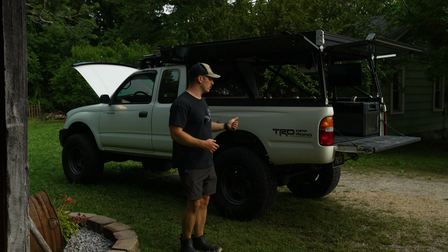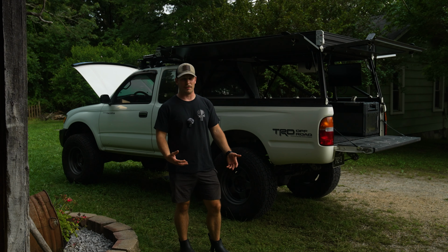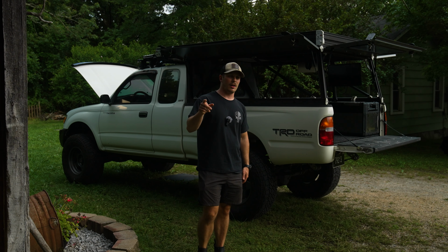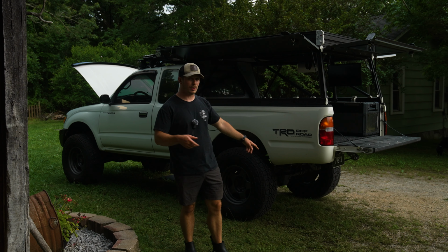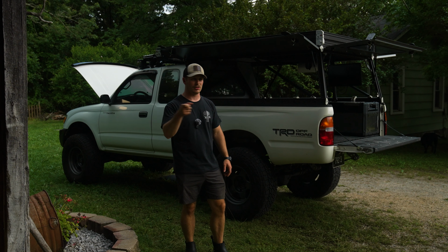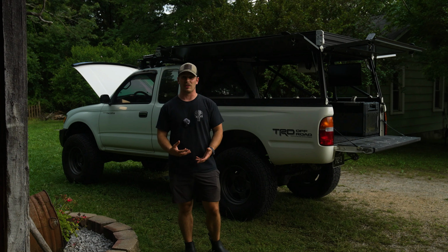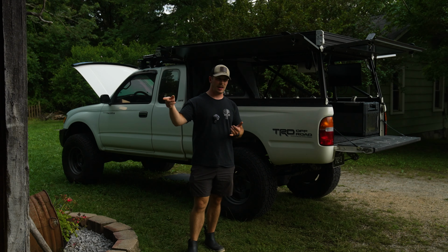But then the bad news, may as well break it to you because it's not something I can solve in today's video because I had to order parts. Essentially, that P0420 code that I thought maybe my catalytic converter was bad or something else was going wrong. I hopped underneath the truck this morning, put my vacuum on blow and put it up the tailpipe so that I could spray down the exhaust and see where soapy water was bubbling from, and see where the exhaust leak, if there was any, might be. I discovered that there was a massive exhaust leak from the O2 sensor, the one that is upstream from the catalytic converter.